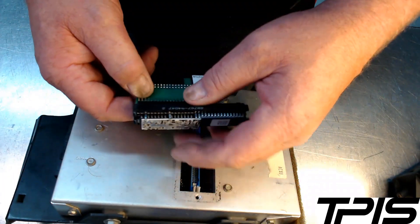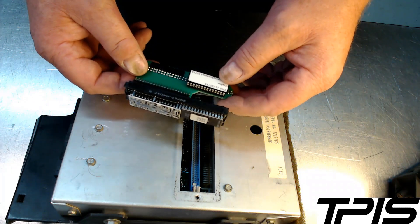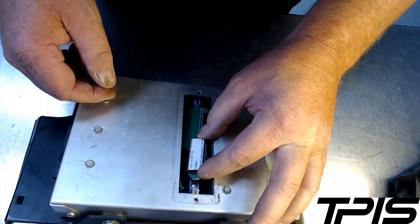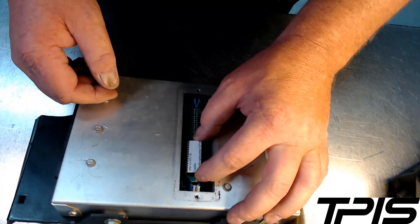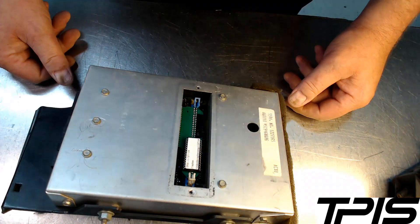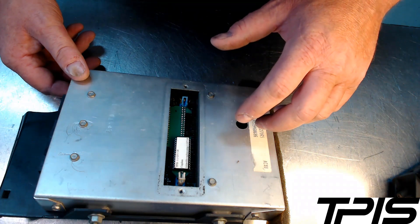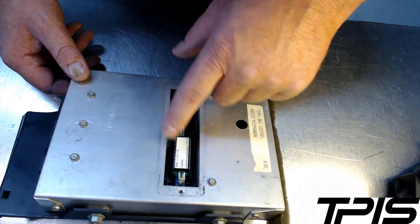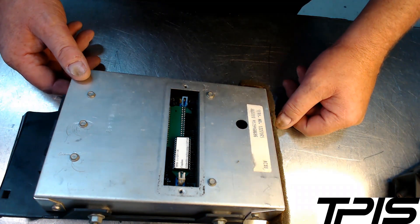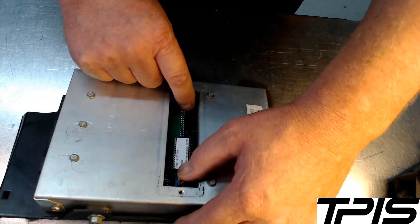It's very important that you line these two up correctly — otherwise you'll put it in the car, the car won't start, and the check engine light will be on. So tuck this in here, wiggle it around a little bit, make sure the adapter is lined up in the socket appropriately, and just push down on it. You'll see those tabs come up, and that's basically it. I do recommend, when the car is running and all that, putting this cover back on — that helps keep any small sockets or tools from falling in there and causing a short circuit on the circuit board. That's 86 to 89 TPI.